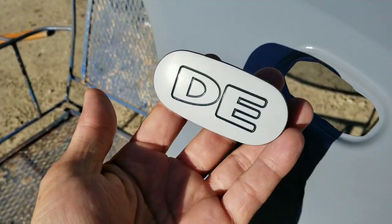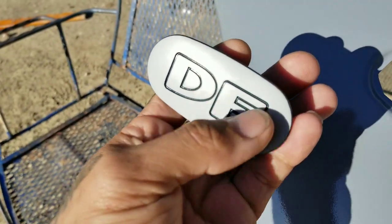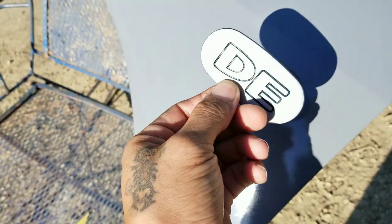Right here is where an emblem would go. It was the same color as the car, so I just went ahead and sanded the face and left some paint on the inside — it's just gonna go right there. It doesn't match the color but that's alright, it's plastic anyway. You can see some of that orange peel right here, so I'm gonna sand it down with 2,000 grit since it's new paint. If that doesn't cut it, I'll go down to 1,500 or 1,000 and work it from there.